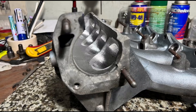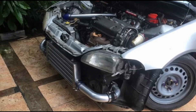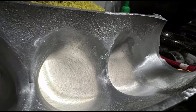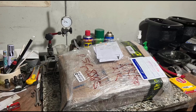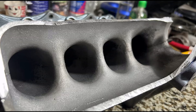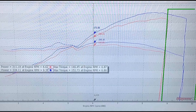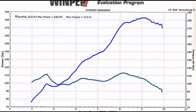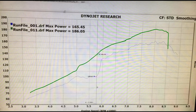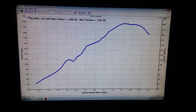After the good result of the p30 manifold — people might think I'm against the Type R but I'm not, we simply made the p30 perform better. Zef sent me his intake manifold for some port work; this is a p73 Type R manifold. Now we can discuss what we did with the dyno, calculate the runner length like we did with the p30, compare both manifolds ported, and show the dyno of each engine — both B18s, one ran a p30 and the other an ITR manifold.